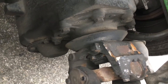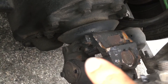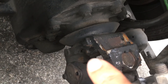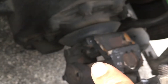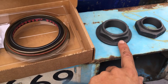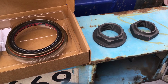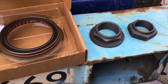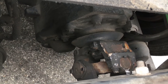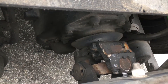So in order for you not to make that mistake, I'm letting you guys know — that nut in that knuckle, the seal goes back here and then this nut pushes it that way. So that nut right there, which is this lug nut right here — do yourself a favor and replace it. Don't reuse the old one, because you have a 50/50 chance of that seal leaking again.